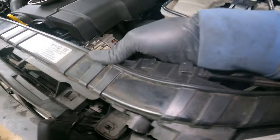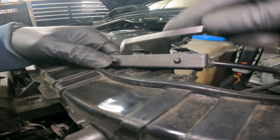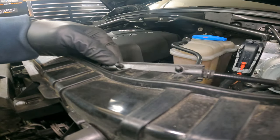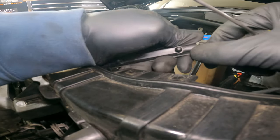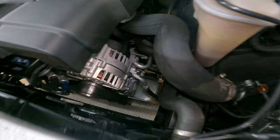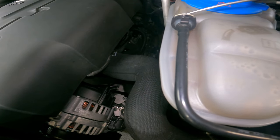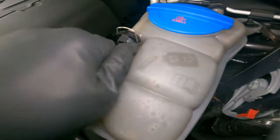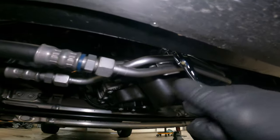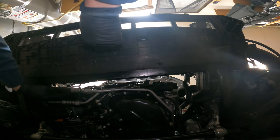I'll show you how to disconnect this hood latch right here and then we're going to be disconnecting this bumper down here. We're just going to barn door this thing up a little bit — pull it out a few inches because really all I need is a few inches to get my hand in there and work around that. Pop those teeth and kind of pry it out. Same thing down here — put a little tension on it. Put that somewhere safe. Then it'll pop the little door open and pop out just like that. We don't want to put any pressure on this little plastic line. The other coolant hoses have a little bit more give — enough to get up in here. Down here we're going to disconnect the transmission lines just from the front — this will give us a little more room.